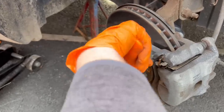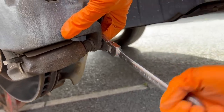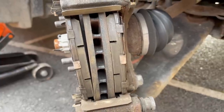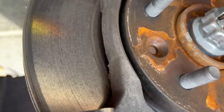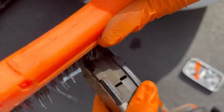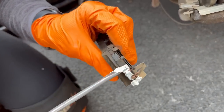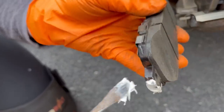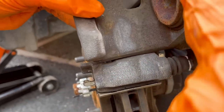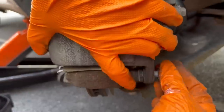Now I'm on the brakes. First of all the hubs need a brush up — I'm not a fan of copper grease, it gets everywhere and I much prefer this method. I remove the M8 nut from the base of the caliper and this allows me to access the front pads. These are in particularly good condition and clearly not seized, but you need to strip them to find this out. So we'll carry out our normal cleaning and greasing of the pads. The Leaf suffers with corrosion on the inside face of the discs but these are fine. I cleaned out the pad wells, cleaned the pads themselves and gave them a good inspection. I'm now applying ceramic brake grease, designed for exactly this, which will stop the pads seizing over time and make sure the brakes wear evenly and perform properly when needed. The sliders also get the same treatment as these have a tendency to seize up too — just remember to wipe off the excess. We can refit the pads and they slot in very nicely. I now pull the caliper down and refit the M8 nut. Under normal circumstances without filming, each wheel would take approximately 20 minutes.